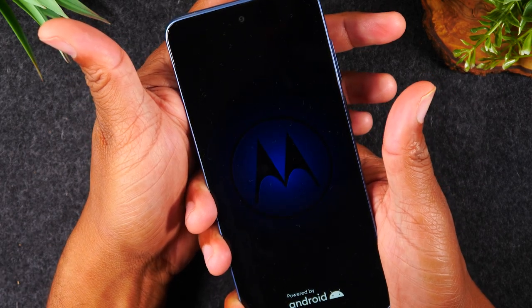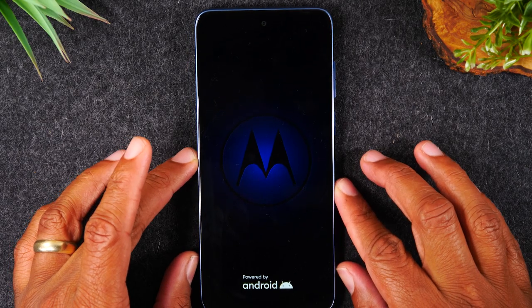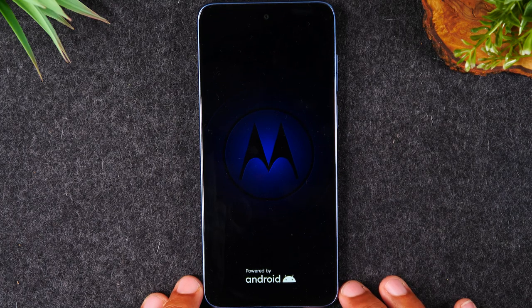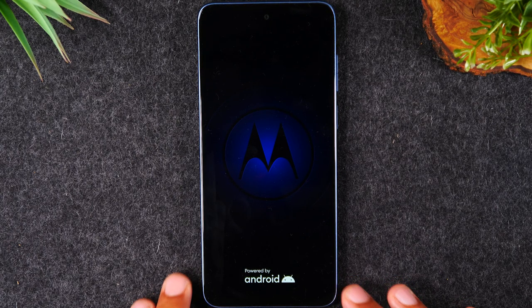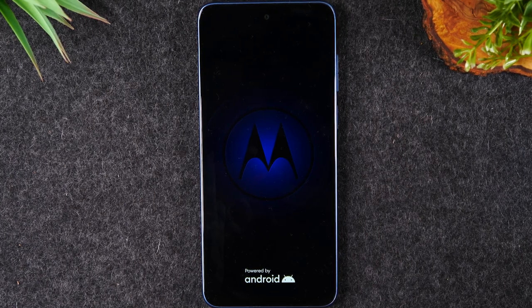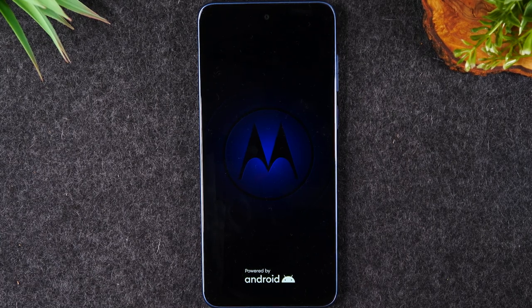You can let go of the buttons as soon as that screen goes dark and now give your phone just a minute to restart. Once the phone restarts, usually if there was an app or something that was causing your phone to glitch, this will fix it and the touchscreen should be working once the phone finishes restarting.